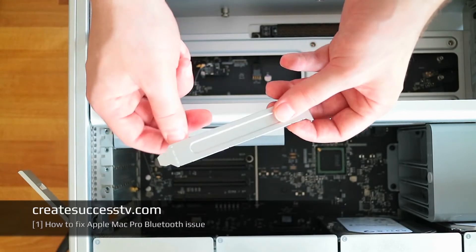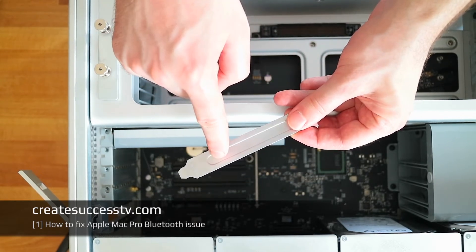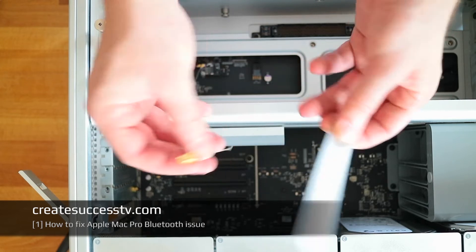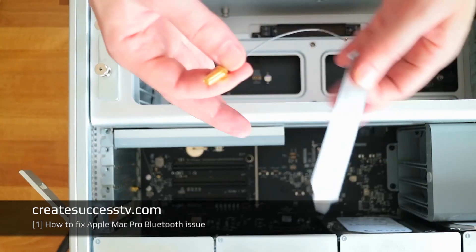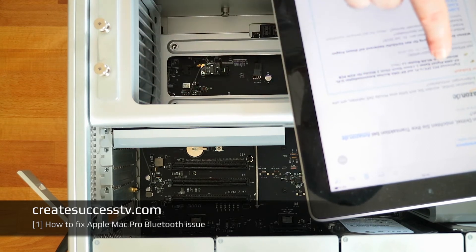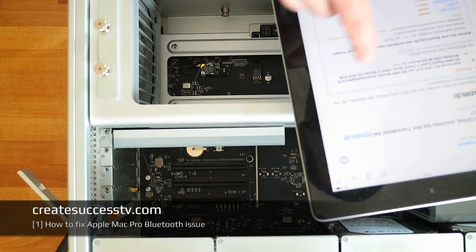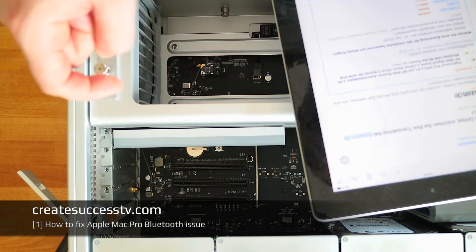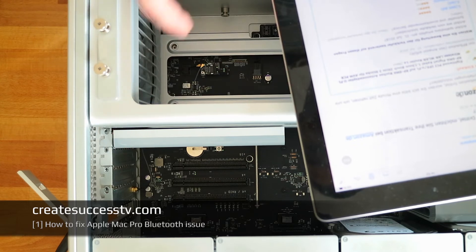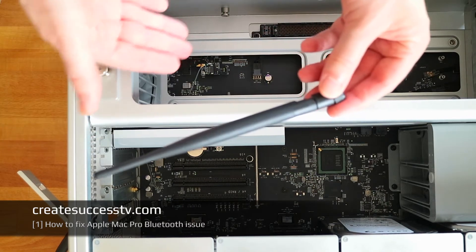The cheap package with the antenna and cable was too short. I had to go online again, look on eBay, and buy a cable that was about 20cm in length. You also have to remove the bracket on the side and take out the PCI Express slot cover. Then I took a metal drill and drilled a hole through there so I could attach the antenna. After that, everything worked fine - the Bluetooth issue with the mouse that was sluggish totally disappeared. The connector name, I think it's called PCI IPX U.FL to RPSMA - I'll put that in the description below.